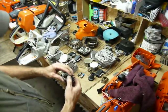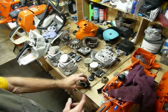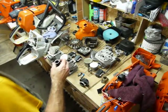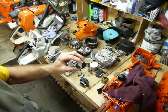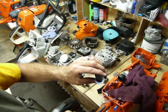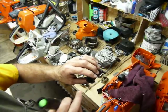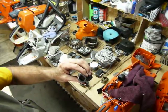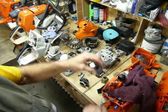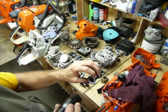If we look at the intake manifolds, we see a nice big open hole — smooth as silk, straight shot going into the back of the cylinder on the Husky. If we look at the Stihl version, we see that it has some little pyramid-shaped rough patches — there's a patch that runs kind of in a circular fashion. Those are for roughing up the airflow, possibly to get atomization. We already mentioned atomization is supposed to happen when the piston's going up — the charge starts to move around as it's compressing in the combustion chamber, that's where you get your turbulence.